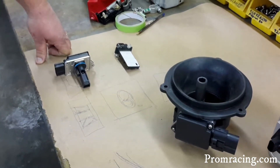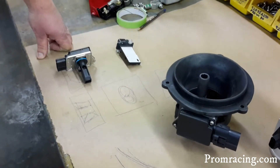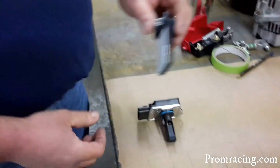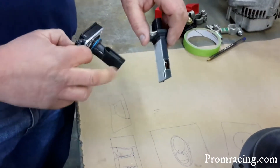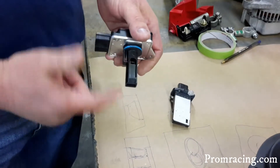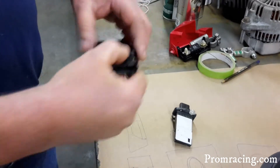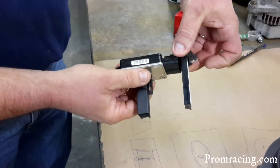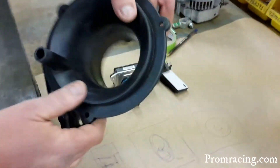In the video we talked about reversion, and you mentioned some of these meters handle reversion a little bit better. Let's talk about the tonsil and the slot style first. The way the slot style sensor and the tonsil sensor handle reversion is virtually the same — air enters through the front. On the tonsil sensor it enters here and comes out the bottom. When air is going the other direction it really doesn't do anything, so they're both doing approximately the same thing.